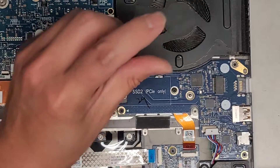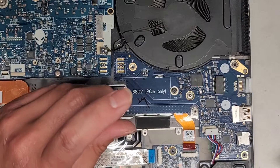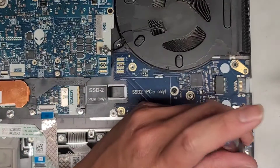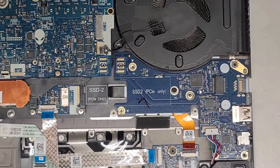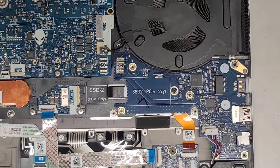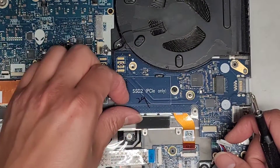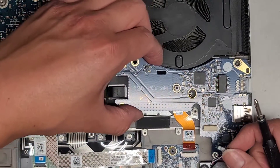We're going to get all of this out. Hopefully their video card's not like dying or failing, because sometimes taking it apart and doing the thermal paste is enough to get it to stop working completely. Usually what happens is after it gets really hot and cold, the solder cracks, and then it's just barely making contact. When you take the heat sink off because it pulls on it or twists it, it sometimes makes that small crack misaligned, and it's enough to make it not turn on anymore.